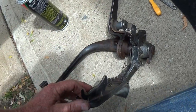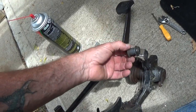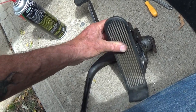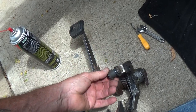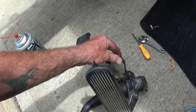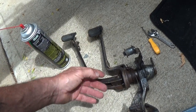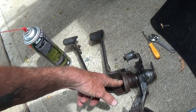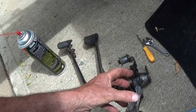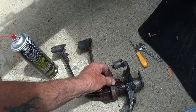Everything else seems to be in pretty good shape. Things you'll run into: the gas pedal is all worn out, the little plastic nylon roller that goes on the roller and goes back and forth — a lot of times these break and wear out, and a lot of dirt piles up in there so you don't get full throttle. A little lubrication helps, but this thing should really come out, get a good cleaning and lube, and be put back together. Springs can break too.